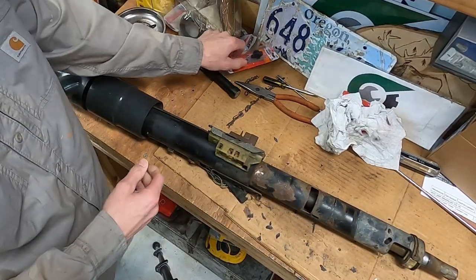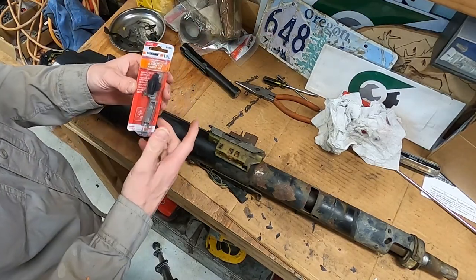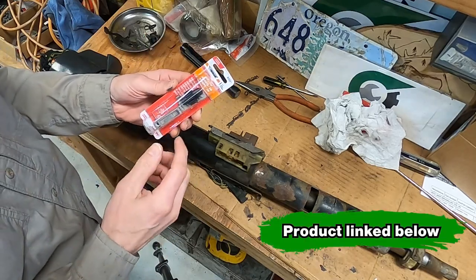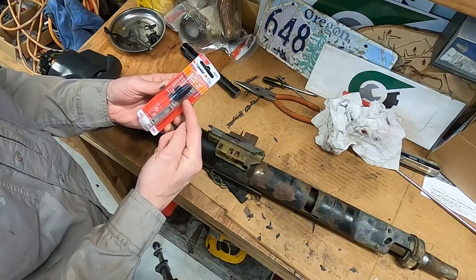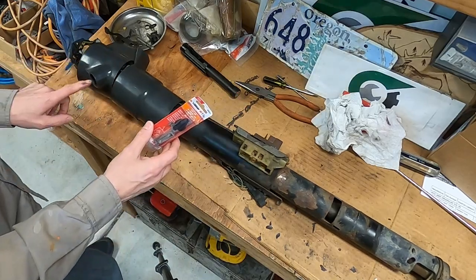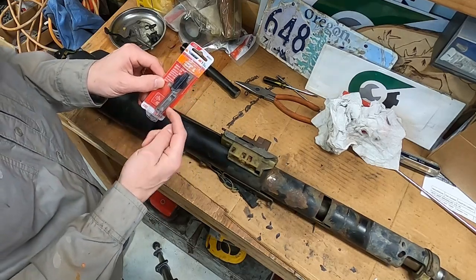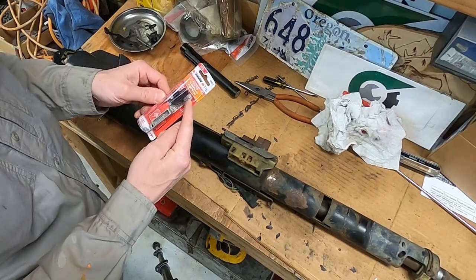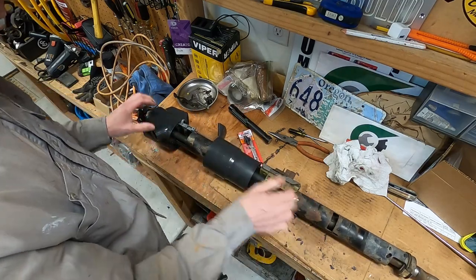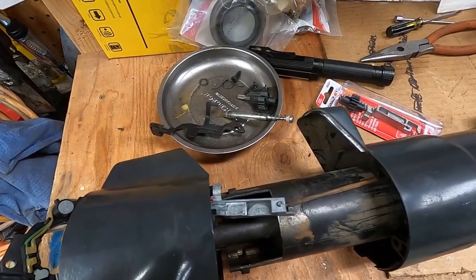Let me take you through the process of putting in our new rack and sector gear set. This is from Dorman - I'll include a link in the description below. If you are replacing just the gear, you don't have to take your column all the way out or all the way apart. You can actually do that right through the ignition lock cylinder right here. But because I need to also replace the rack, I had to take the column apart to get to it. But we've got all these little parts and pieces, let me show you how this all goes back together.